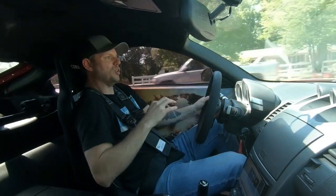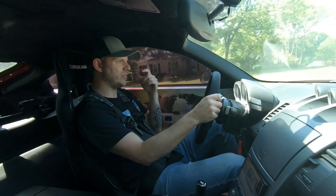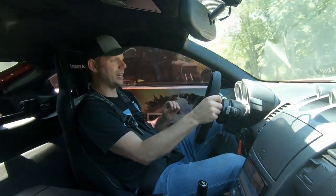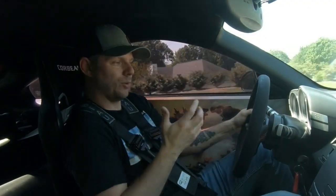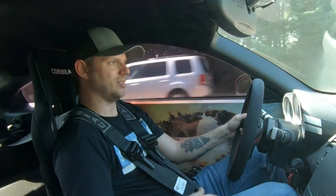The car doesn't seem to move as much. It seemed like it was squatting a lot more in that last test video. The car feels planted, more connected. It feels like the power is being transferred more directly to the rear wheels, which is great — that's what we're here for. Chirping second gear even with just a short shift — that tells me that torque is being transferred directly to the wheels and getting to the ground. That's definitely good.